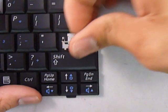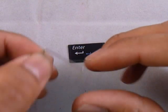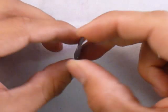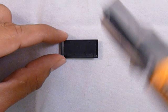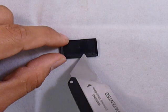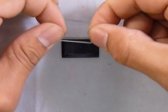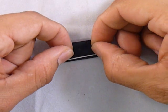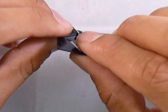For a large key it's the same procedure, except behind the keycap there's a metal wire. Turn the keycap over — you can see four hinge fittings: two at the top and two in the middle at the bottom for the hinges. The fittings at the very left and right at the bottom are for the wire. Place the wire between those bottom fittings in the middle and push it down until you feel or hear a click, then turn the keycap over and open up the wire.